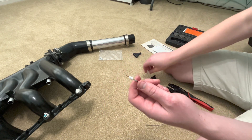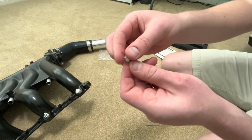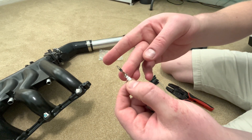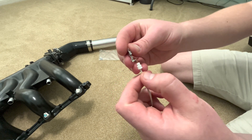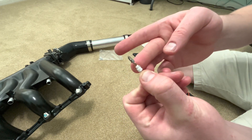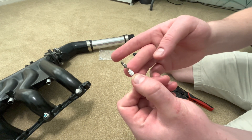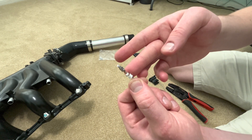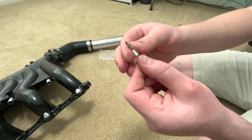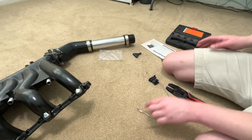So now that's on there. Let's do a little bit of a test fit. Here's our crimp tab. When I have it like that, I can see that I need to actually push this weather seal up more — just like that. Perfect, so that's ready to crimp. You can see the stripped part is just inside the crimp tabs, and the weather seal is over the part of the wire that has not had the insulation stripped. It's lined up perfectly with those little crimp tabs right there.